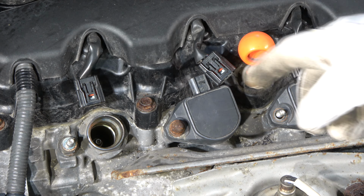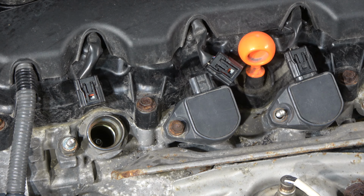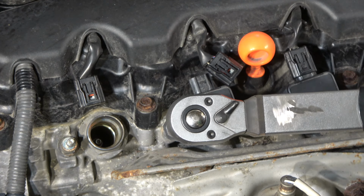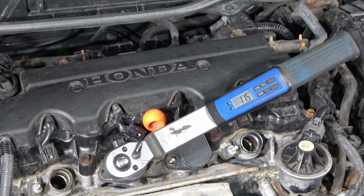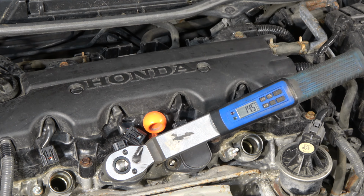Now I rotate that in here and we can look closer. This nut's force is 10 to 14 to 15 newton meters. And let's check using my torque wrench tool. This is this amount. And when we use this torque wrench tool, then we don't break these nuts and bolts. And now we can see how much this force is. Now we can see that there is a digital meter. Now there is like 11, 13 and 14. 14 is like the maximum amount.